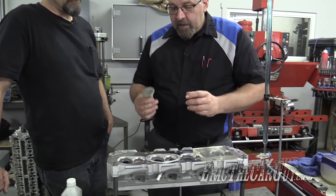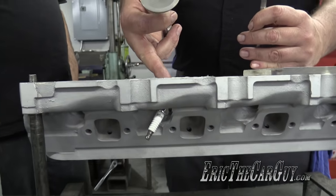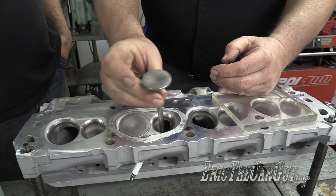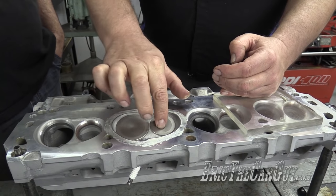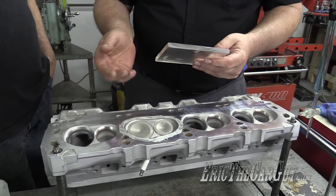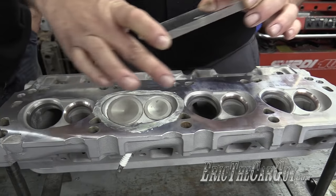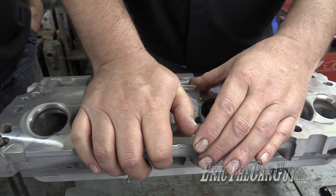We just need valves for one cylinder, a spark plug that you're going to use, and some Vaseline to seal the valves. And so you put a little bit of Vaseline on the valve face. So that'll seal. Plexiglass plate, you can make your own at a hardware store. I believe this is something I made, or a buddy of mine made. And I know she also put a little bit of Vaseline around the outside of the combustion chamber. That's going to seal that. You put the hole to the highest spot.